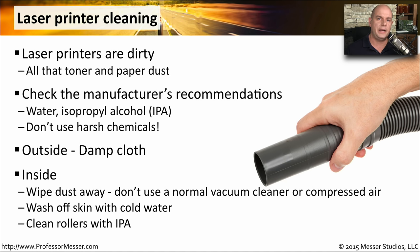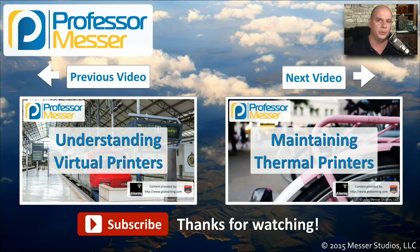On the inside of the laser printer, you want to be very careful about spreading dust around, so we don't generally use compressed air. We don't even use a regular vacuum cleaner either, because the toner particles are so small you would need a specialized toner vacuum. Instead, we generally wipe the dust away with a damp cloth. If you get any toner on your skin, don't use warm water — use cold water. That way you won't melt the toner and have it stick to your skin even worse. For the rubberized rollers inside of the laser printer, you might want to use IPA — isopropyl alcohol — which will clean the rollers and keep them able to grip the paper as it goes through the printer.